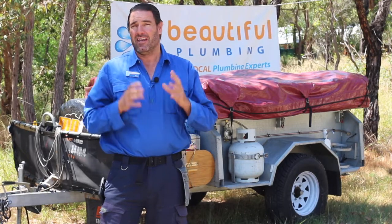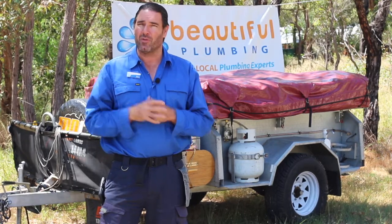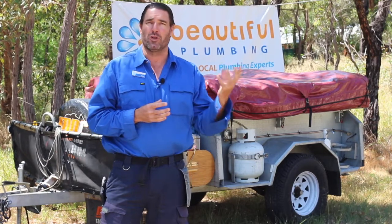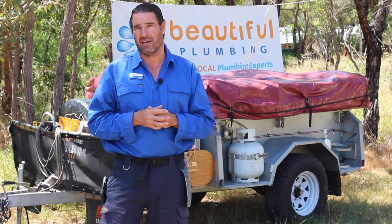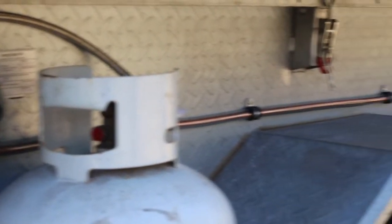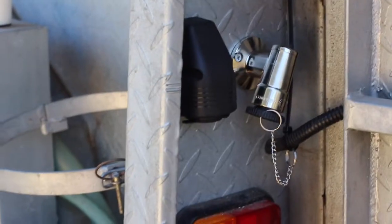This is an MDC Gal. Now, great camper, but the owner wanted to be able to leave the gas bottles in the gas bottle holders. He wanted me to install a bayonet up the back so he could connect up his barbecue or his gas stove without tools. So by installing a gas regulator near the bottles and running a short gas main to a bayonet on the rear of the camper, it will save a lot of time and relieve some of the pain points when camping.